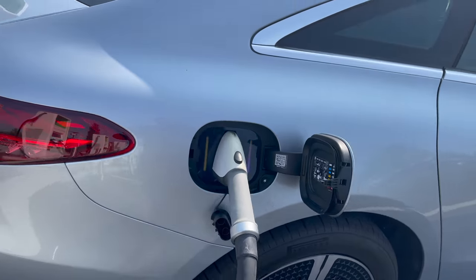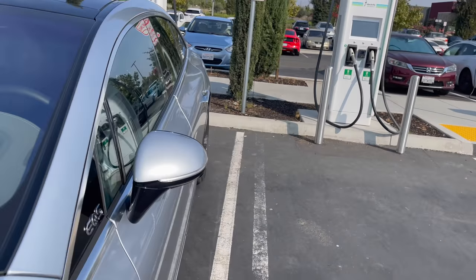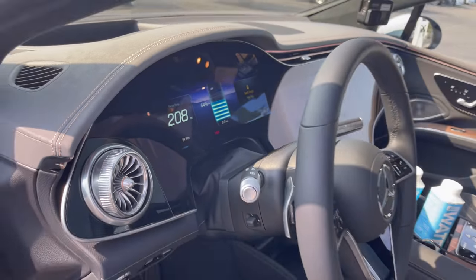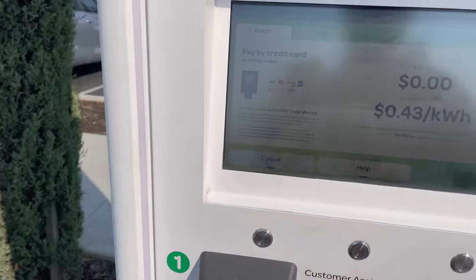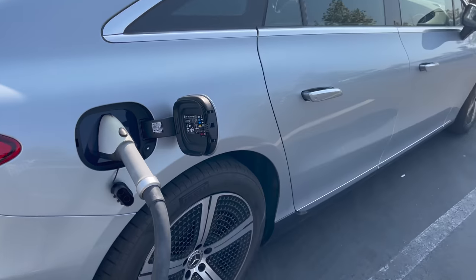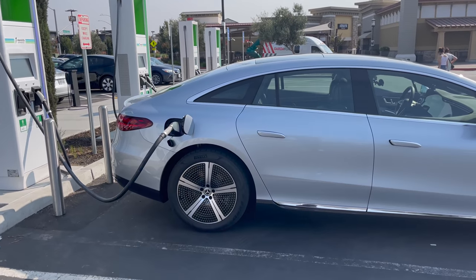Plugging in — will the car show us kilowatts, how much we've added? Plug-and-charge doesn't appear to be working, so I'll activate with the app. I care more about charging speeds anyway. Ramping up: 20 kilowatts... come on... 60, 80, 100. It's ramping slowly but nicely. I drove here with the navigation programmed for the fast charger, so it pre-conditioned on the way — warming or cooling the battery. Then: 150, 151 kilowatts — cooling fans kicked on outside. 154. Seems to be leveling off.